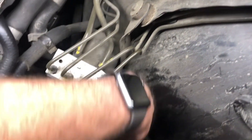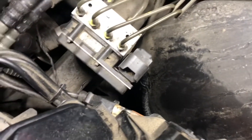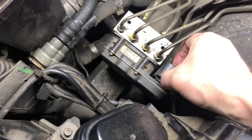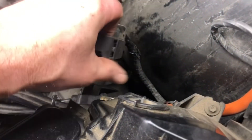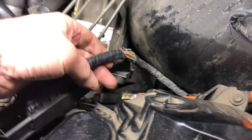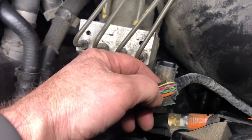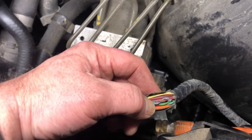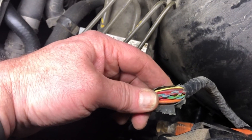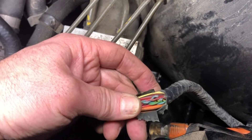You can see the wires are rubbing against the wheel well. When I pulled this out, you could see those wires were totally rubbing — especially the blue and red ones. On that left wheel sensor above the tire, the wires are also blue and red, and the blue wire there was totally rubbed in two.